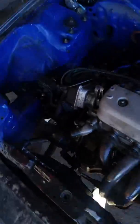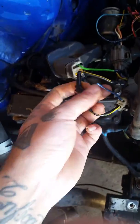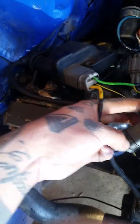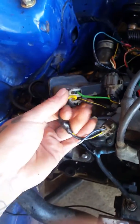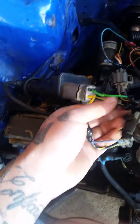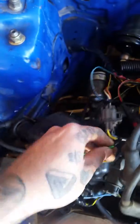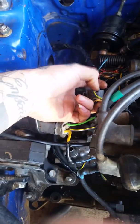For the exterior coil, here's what you need to do. This black-yellow wire goes to your distributor — I have mine cut because the pin was messed up so I wired it directly. But the black-yellow that comes out of the harness from the firewall side, you put it to the black-yellow on this connector. The part going to the distributor goes to the yellow wire, and there's an extra green pin on the new distributor — you wire the green one to that.